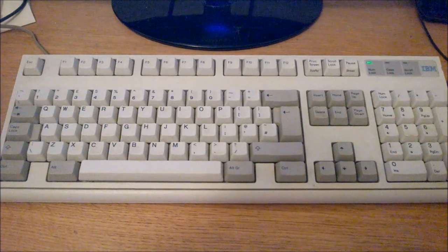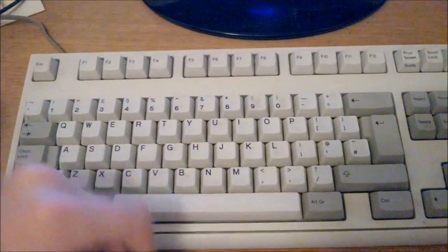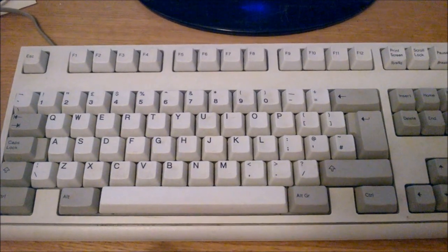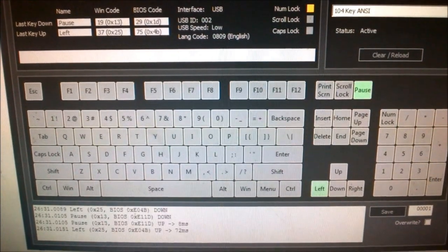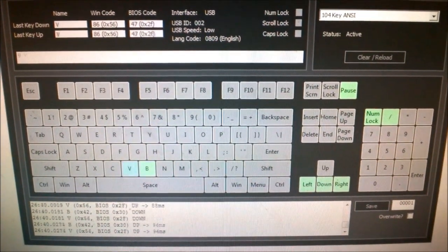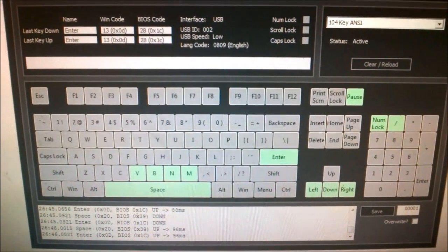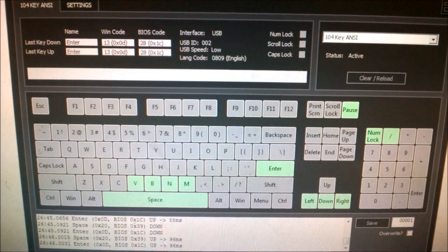I'm recording this part of the review before I clean it because I want to show what can go wrong with these boards. Due to a fault in either the membrane or the electronics, some of the keys don't work properly. Specifically, the E and C keys barely ever register. And a whole bunch of other keys are teamed up, meaning if you press one it will also trigger another. For instance, if I press Left, it always also triggers Pause. If I press Down, it triggers NumLock, and Right triggers Divide. V and B are teamed up, as are N and M. And most annoyingly, Space and Enter trigger each other, so every time you space two words you also put in a new line.